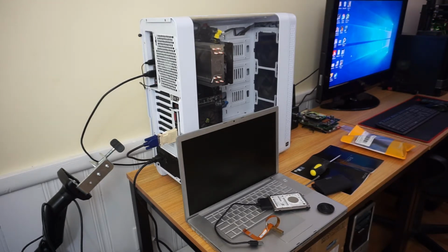This i7 6700 is driving me crazy. I'm going to take that chip off that EVGA board, the Z170, and put it on an H110 that I built in one of those little tiny setups with a $39 CPU. It's an 1151 socket. From what I can tell, it should work. That'll tell me if it's a problem with the motherboard or the graphics.